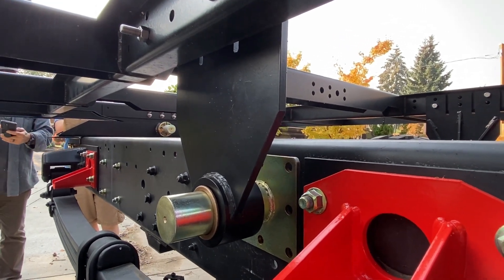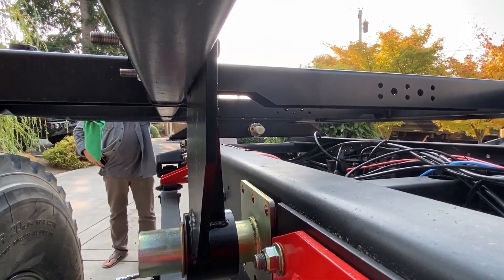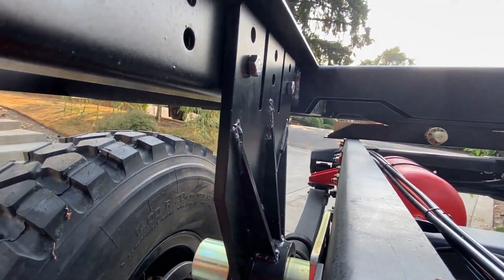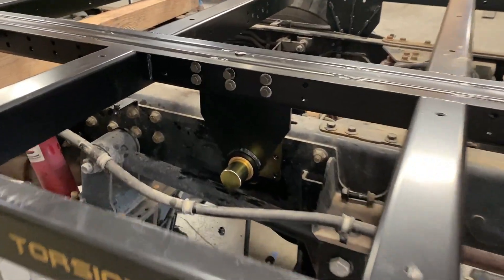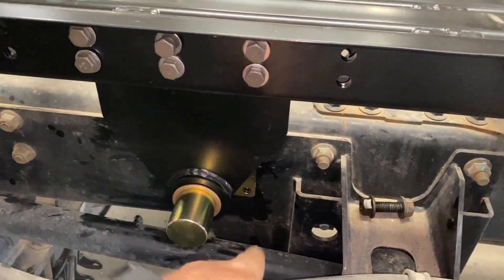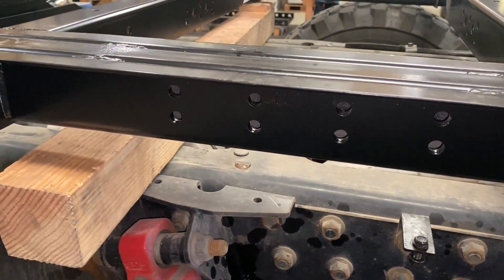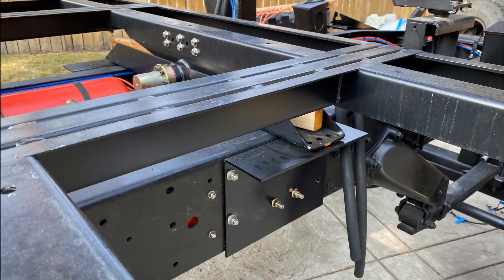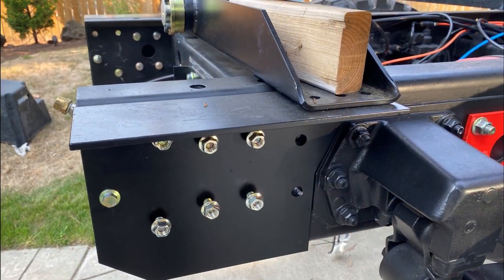Generally speaking, the side bracket pivots for a 4-point diamond-shaped pivot system should be placed close to the rear axle so that when the axle moves with terrain, the side bracket pushes and pulls on the subframe and habitat to keep it clear of the rear tires. Vehicles with 4-point subframes and pass-throughs must opt for a middle ground between the rear axle and cab — usually this means mounting the side brackets as far forward on the weldment as possible. The good news is our subframe weldments are designed for both 3-point and 4-point configurations in the same weldment, giving you ultimate flexibility.